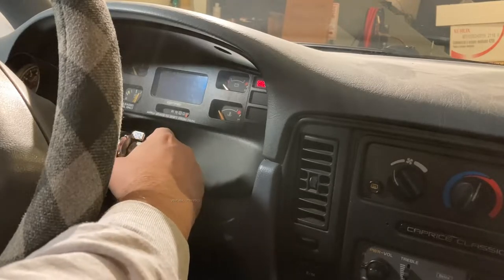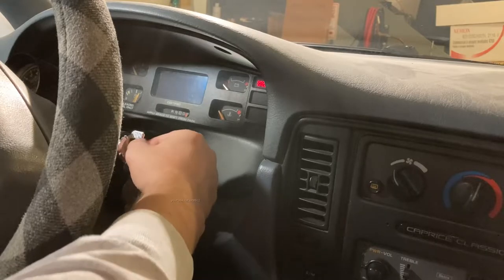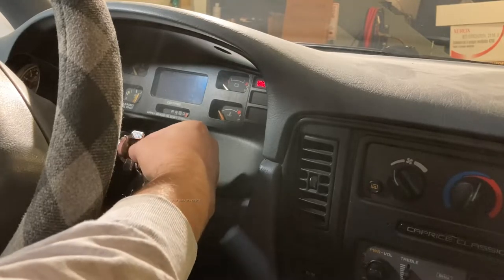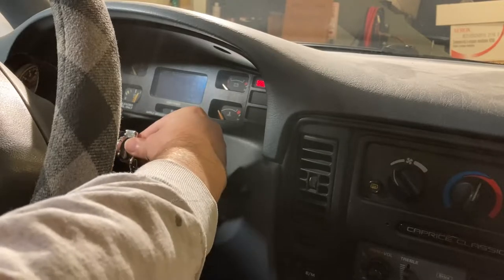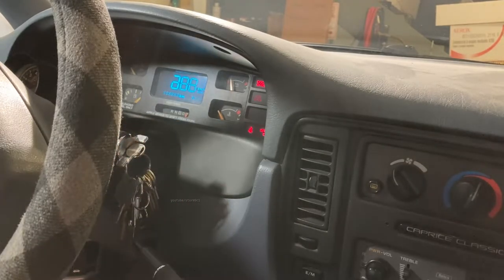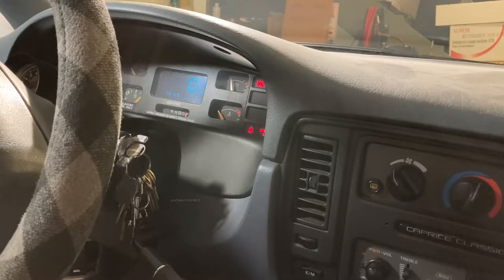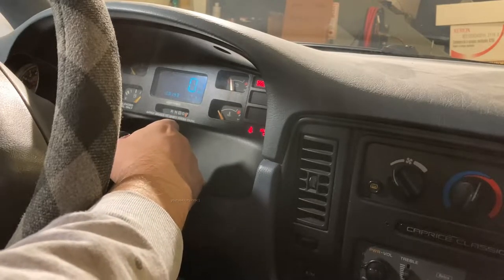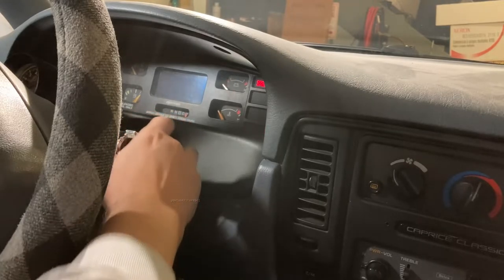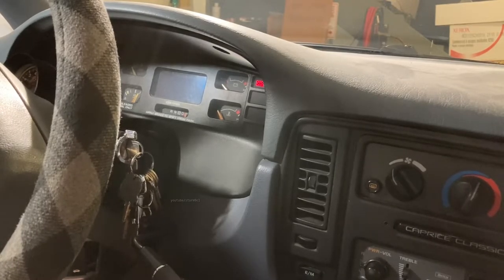We're not even going to be able to take the key out, so the key just has to be left in there. If your car dings, pulling the key out a little bit will usually stop it. If you turn the key all the way on and leave the cluster on, it'll stop dinging but then you'll have power to the cluster — that's not ideal but it won't hurt anything. You can also remove the dinging module under the dash or disconnect your battery. A lot of factory service manuals recommend disconnecting the battery any time you work on electronics, and I'll make the same recommendation, though I'm not doing so today.